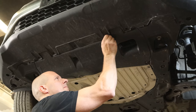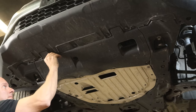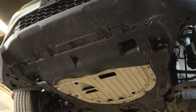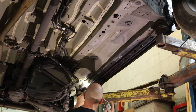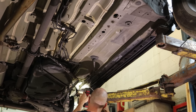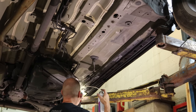Now we have our car up on the lift. We'll put our little push pins in the bottom of the bumper — we just left them out because it was easier to get them in now. And what do you know — we got an empty bucket! So now we're going to cavity wax our rocker. We did the top of it before and just waited on this because I knew I'd be putting it up on the lift, and it's a lot easier to do it now.